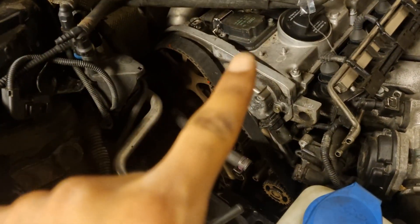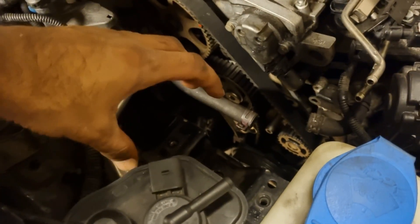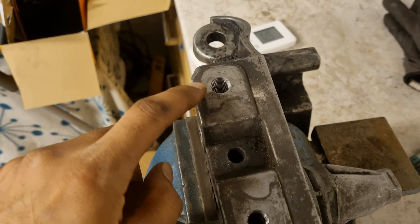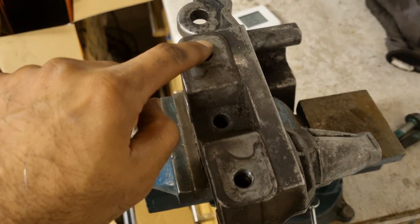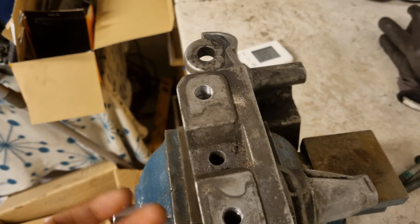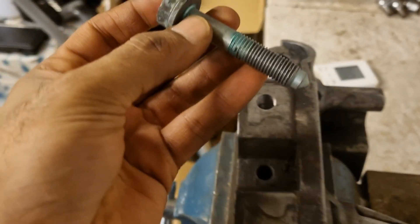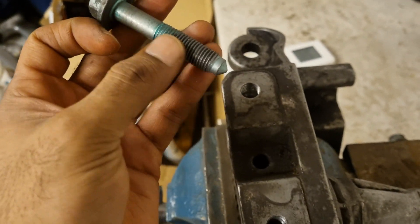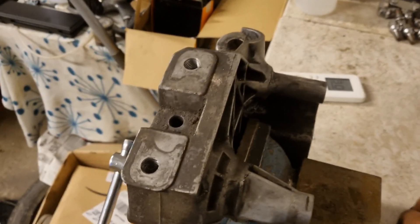The real problem is not with the timing belt and its parts itself, but with the engine mount that sits with the engine — not the top mount. The good rubber one has an aluminium piece to keep the weight down, and this needs almost 100 Nm of torque. If you keep torquing these screws again and again, they strip out. You finish the timing belt, put everything back, tighten to 100 Nm, and the bolt just spins free — and when you pull it out, aluminium threads come with it. These two holes are almost damaged.